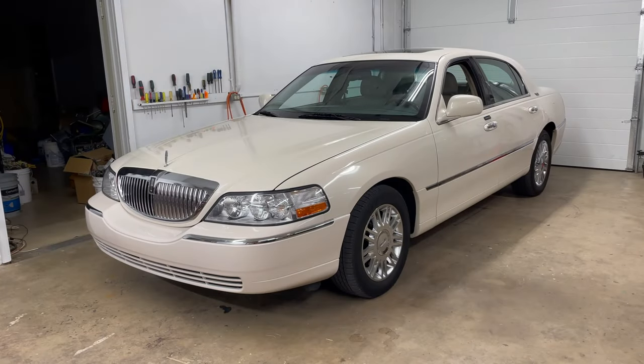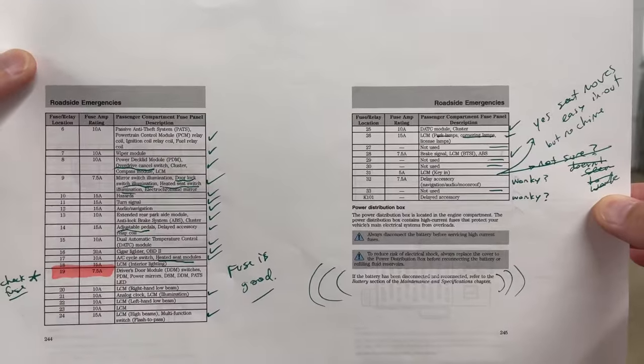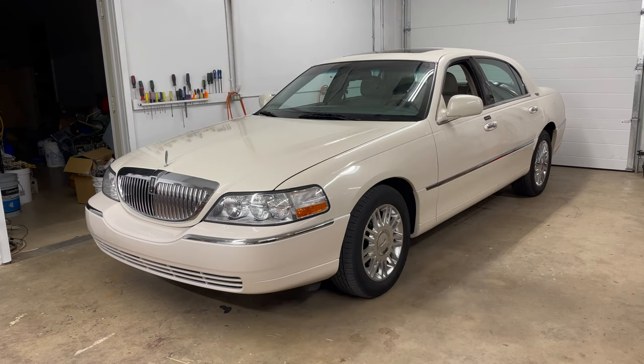So I made a list of what works and what doesn't work — that's a good step to do when you're troubleshooting. The next thing I did was check the fuses from the owner's manual related to this system. All the fuses were fine. Then I checked the wires in the driver's door, because sometimes those wires can get broken or cracked. My wires were fine, so I knew the wiring and power were good.